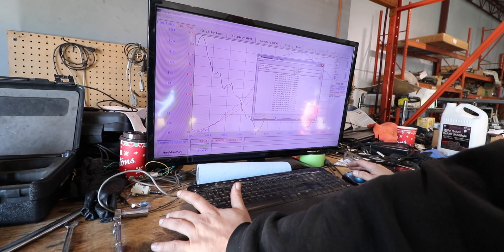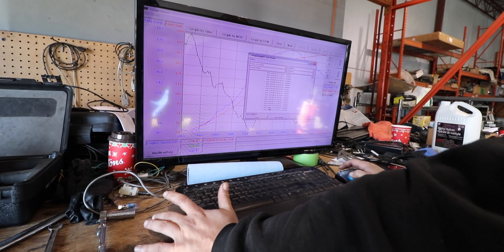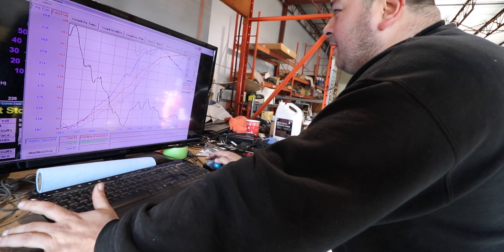About time I hear this thing boost! Oh my god - yeah, we're only at seven pounds but okay. The tune is pretty conservative too. We'll get the wastegate and then we'll bring it back. Right now it's on an extremely conservative tune because of the issues we're having. He said: get a bigger map sensor that can read more, get another wastegate that actually works, then we'll bring it back and push it to see the real numbers. Remember the first time we were on the dyno we got to 200 horsepower and then the turbo fell off. He's stopping it at seven pounds of boost because that's all we can really do without starting to break things. But at least for now it runs and I can drive a car, because I haven't had a car in like two weeks.